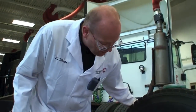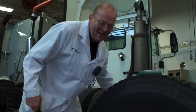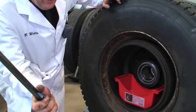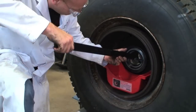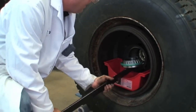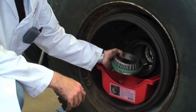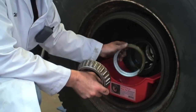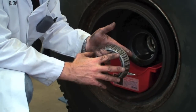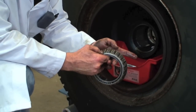What we're going to do next is we're going to pull the wheel bearing out. There are a number of ways you can do it, but the best way is to use a seal puller. We're going to pull it right out of there — watch that the bearing doesn't hit the floor because that can damage it. Now we've got the seal out; that's garbage. We'll take the bearings over, clean them up, and have a quick look to inspect them.